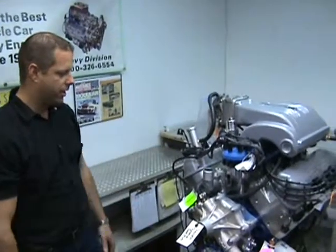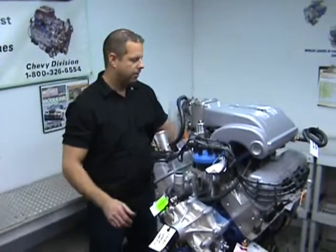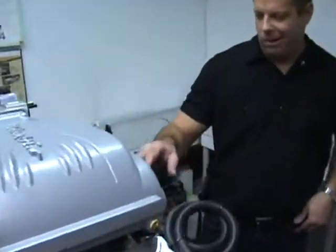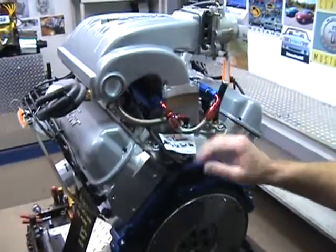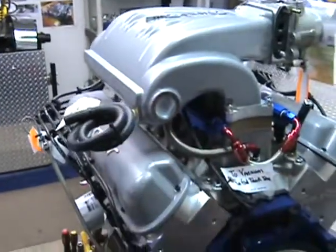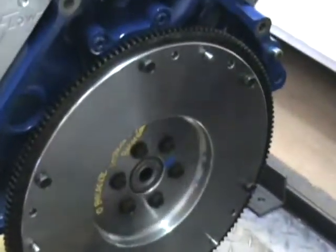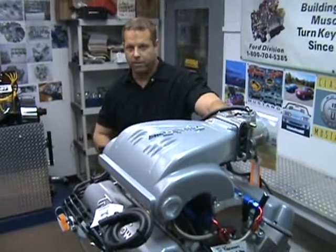You can see basically everything is as drop-in ready as you're going to get. When you buy an engine from Engine Factory, it's completely gone over thoroughly. We've got a fuel rail set up, all the braided lines, PCV valve, braided lines — top of the line. You've got all the tags necessary to go into all your fittings, power brake booster hose for your vacuum lines. You've got the internally balanced Ford's flywheel here, billet flywheel. Everything, when you get your engine, is gone over, so your installation is going to be as trouble free as possible.